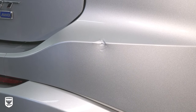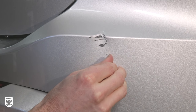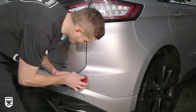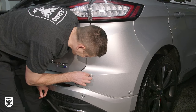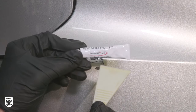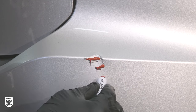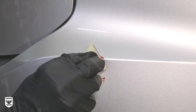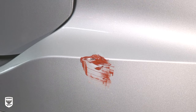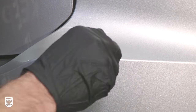Now that I'm getting a baseline for the wrap material and its usage, I wanted to start over and remove the original stickers to see how good I could get the wrap to look. For test two, I went with a slower, more methodical approach. First, I sanded with 3000 grit to clean up the ridges and to scuff up the area for the putty. Then I cleaned it with isopropyl alcohol. Next, I filled up the impact damage with Scratch Wizard's putty or Bondo that comes in their kit. The abnormally challenging aspect of this particular repair is one, it's on a body line or a ridge line, and two, the impact has pushed part of the plastic upwards causing a bit of a mountain or a point. Simply applying putty and wiping is just not feasible here as it is in most cases.